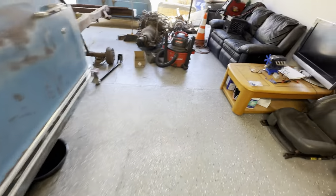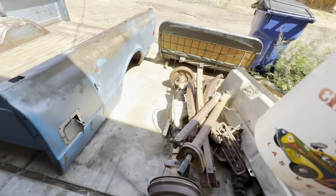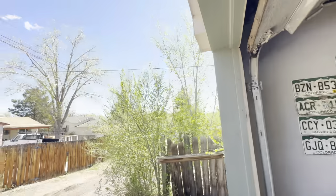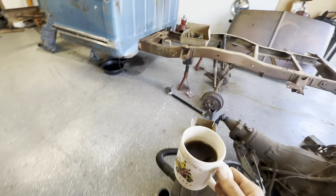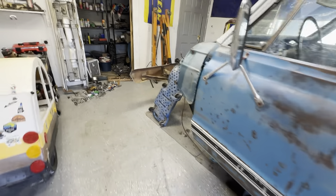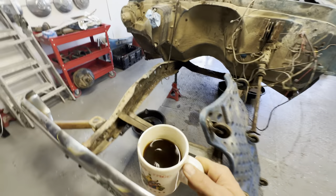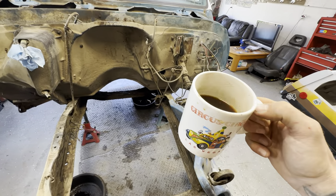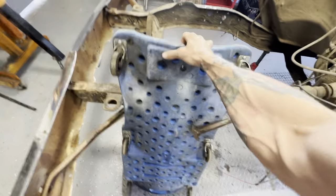So I don't want to Z the frame. What I'm going to do — I looked at lowered cross members, changing this and that, welding on a Mustang 2 like I normally do. When I do four-link with bags in the rear, I'll just buy a Mustang 2 kit. It just welds on. It's a whole cross member that's like a U-shape, already fabricated, and it normally welds to the outside of the frame, so you're not cutting anything or destroying the structural integrity.